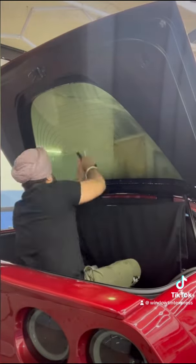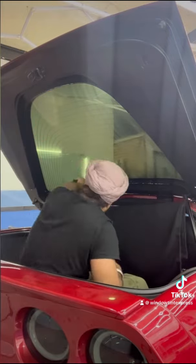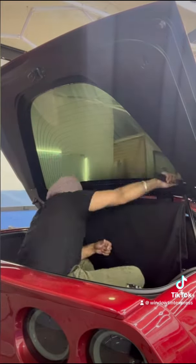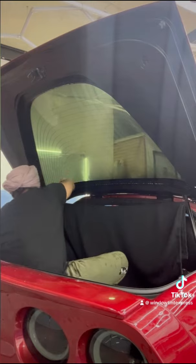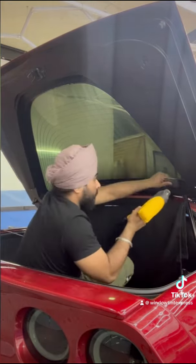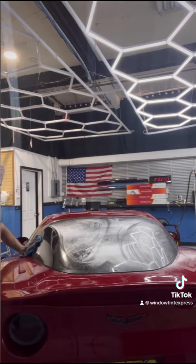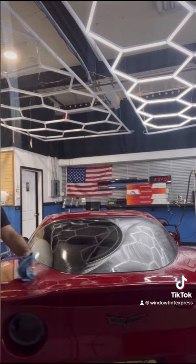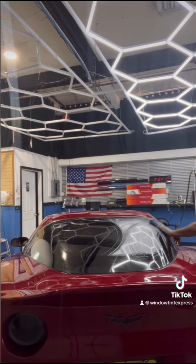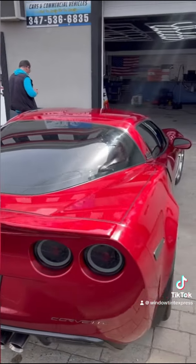Because the windshield is really really curved, you have to squeegee everything the way the film wants to lay down. After squeegeeing everything out, I take my card and dry the edges so there's no water coming back in and bringing dirt into the film. Just take your time with this back windshield — it's not that hard if you have a good film and the skills, because skills definitely matter.